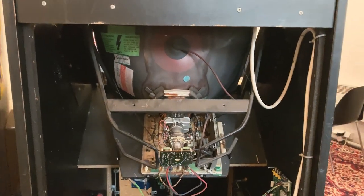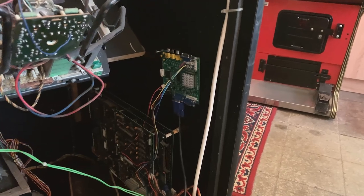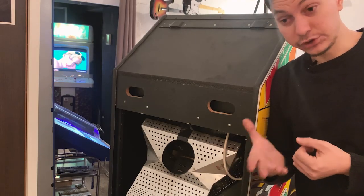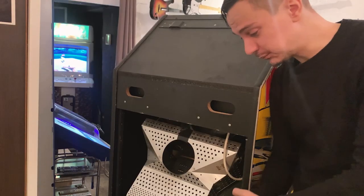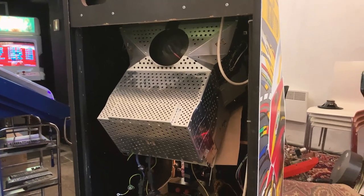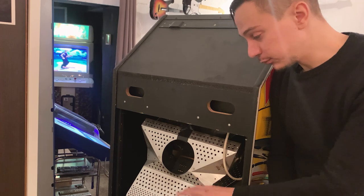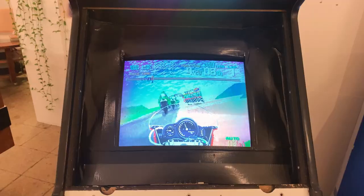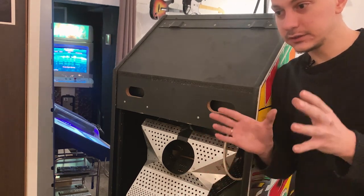For this beautiful arcade cabinet we were kind of sad to just put a flat panel, so we used the same converter — a video signal converter — but this time we used a real PC CRT. It's not easy. We found a really big one to fit in this arcade, but there are many complications. It's really hard to take apart and really hard to get in — as you can see it's bigger than the arcade, so we will cut the wood and make a wooden box to fit it in. I had to leave all the metal shielding because when I removed it, all of the colors started bending. I tried playing with the colors using a magnet to bring them back, but they just couldn't stay right. So we had to put back all of that metal, and only then the colors on the screen were right.